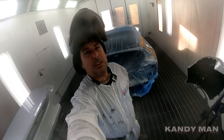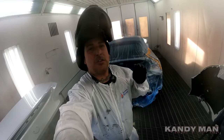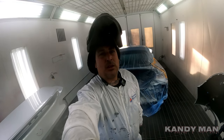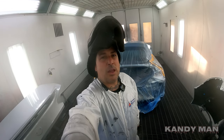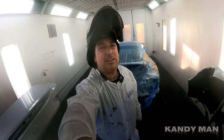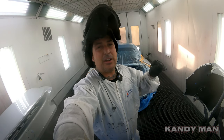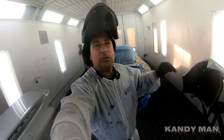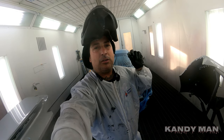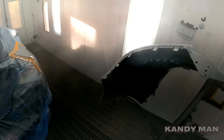Alright guys, so that's the C1 cap with the DV1. I've been using the C1 for all my European jobs lately and I can get a nice glossier finish on them because they're a lot flatter than regular domestic vehicles. When I'm doing a domestic I use the C2, and when I'm doing a European or something I want really nice and glassed out, I'm going to the C1. I see the difference between them both and I like them both — the C1 lays a flatter coat, whereas the C2 leaves a faster coat with a little more orange peel for more of a GM or domestic look. That's the way I'm rolling lately. It came out really nice and flat the way it needed to look.